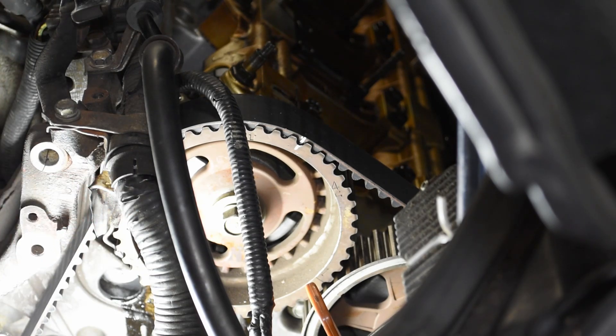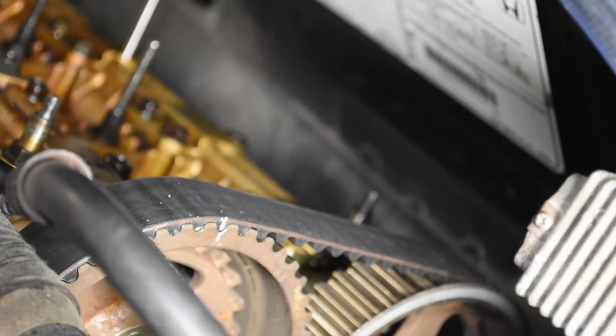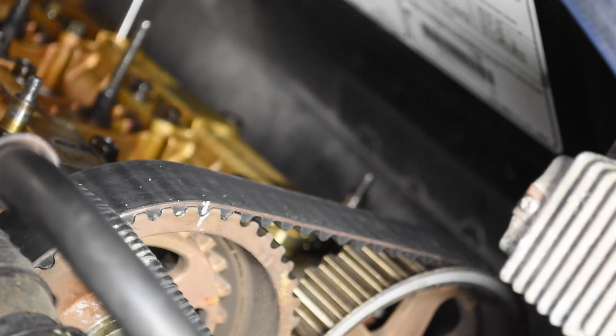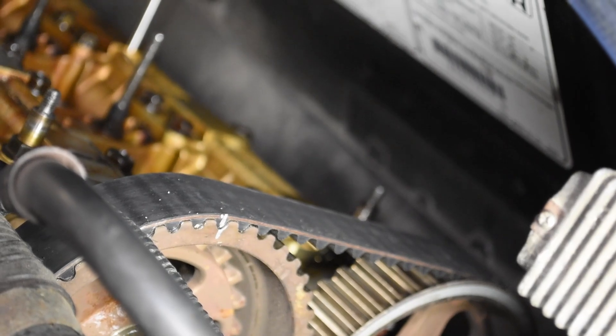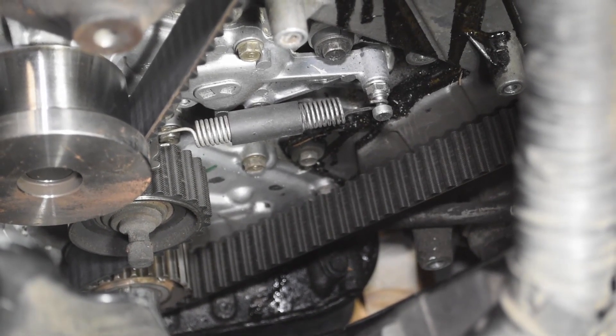I can mark on the top of the belt and wrap the mark over the face in a contrasting color, since I know the faces of the exhaust cams are silver - maybe a dual color solution. Having now marked the belt on all the gears, I'll point out that this should be a redundant step. You shouldn't have to do this, but it was cited in one of the write-ups I read as a cheap insurance policy should things move around unexpectedly. One tip from that write-up: put the match marks on the back side of the belt and pulley, because you can look straight on with no parallax effect using a mirror. Now with my hopefully redundant marks in place, it's time to relieve the tension and remove the belt.